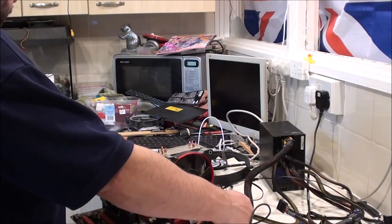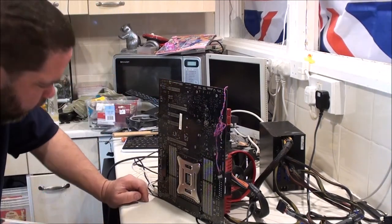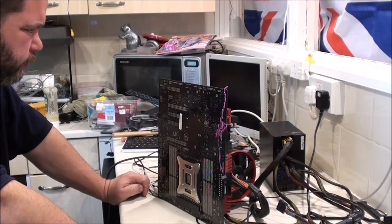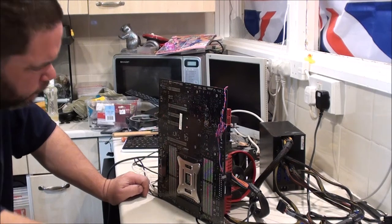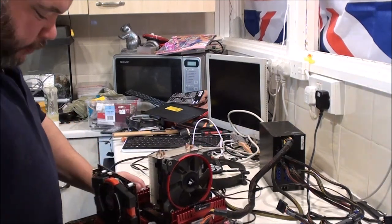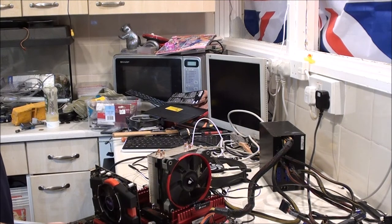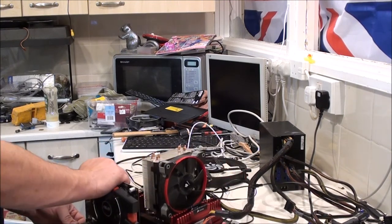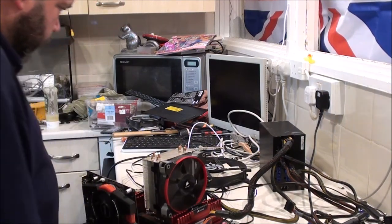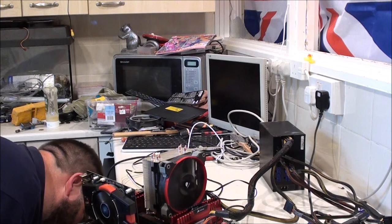See, the little code display at the top here doesn't even light up either. Oh, I'm not seeing anything under here. Reset light is on the switch at the back. Nope. I've even had the BIOS battery out. Oh, and this has got the dual BIOS system on it, and I have switched it using that button. Like I just have. I don't know if you saw that, but the other yellow LED is now on. I get the same issue. I think I said I'd already reflashed the BIOS as well. No dice.